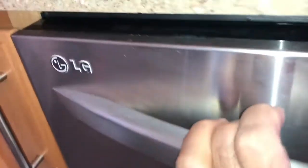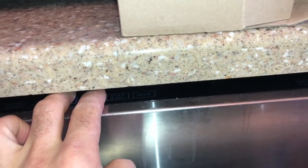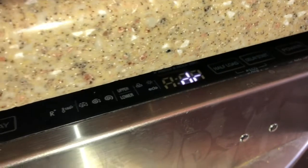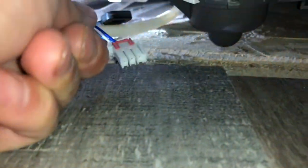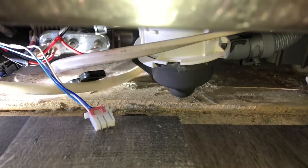Right now it looks like everything's working. The washer would run correctly and then I'd get an error code. Here's a trick: if you hit the Normal button and the Delicate button at the same time and hold it for about three seconds, you'll see 'DR' appear — which means drain. You're forcing the pump to drain automatically. That's it draining right now — I'm forcing that pump.